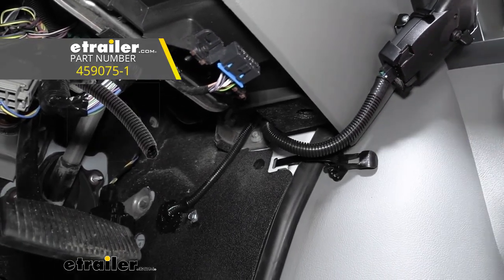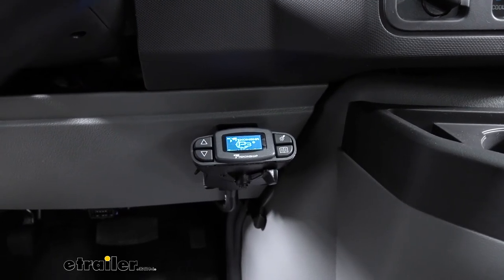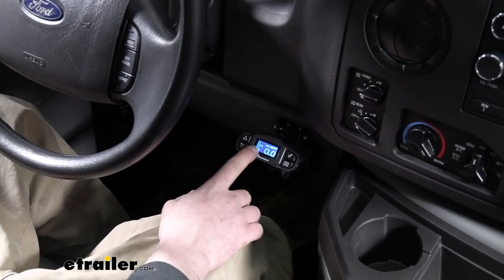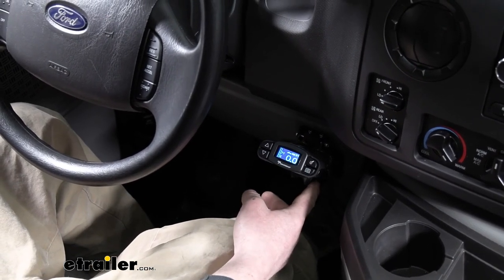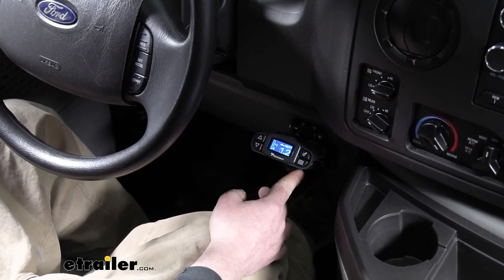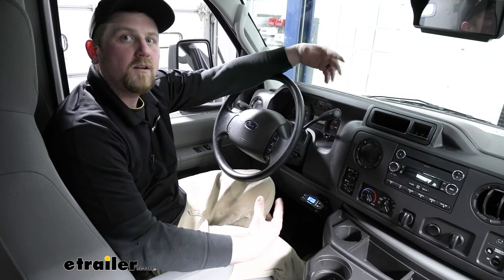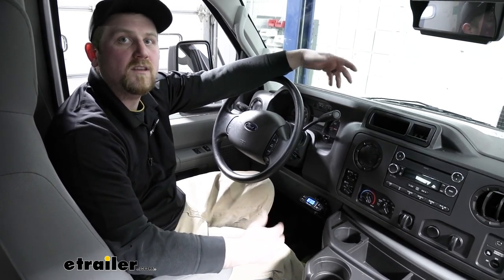Now I'm here at the back of our vehicle — I'll plug our trailer in so we can test the brake controller. Whenever we plugged into our trailer, it recognized it and gave us the output screen. Just to go a step further, if we hit the manual override, we should see our voltage increase, and that's manually applying our trailer brakes. So we've verified it's working properly. And that'll finish up our look at and installation of the Tekonsha Prodigy P3 brake controller on our 2020 Ford E-Series.